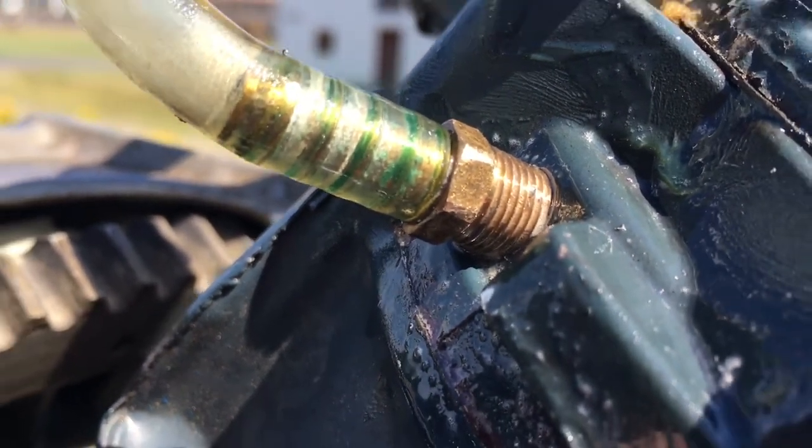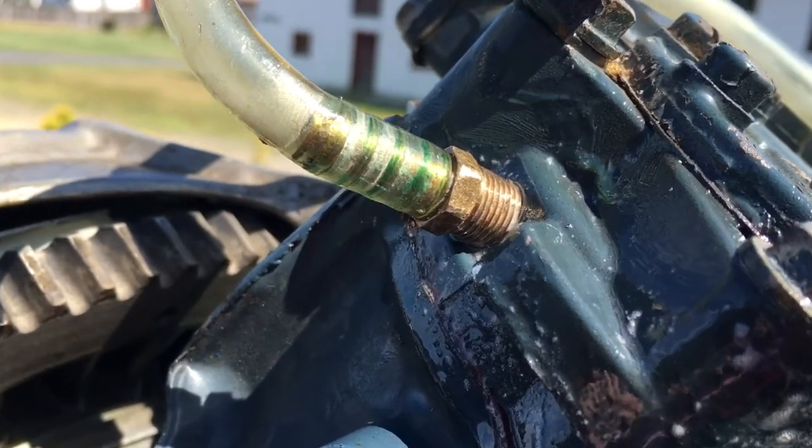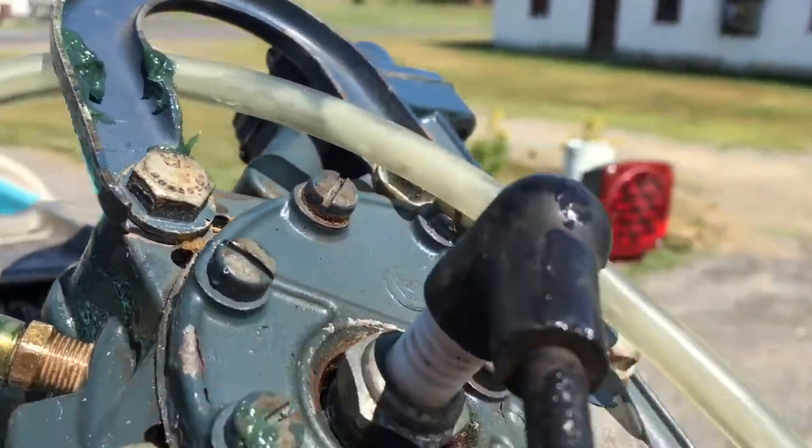You have to be very careful any time you're working with this very soft and old aluminum. You've got to go very slowly and don't put a lot of torque on it. I will put some Teflon probably on those threads so that it doesn't leak, and then I'll just snug it up and route it down around here.